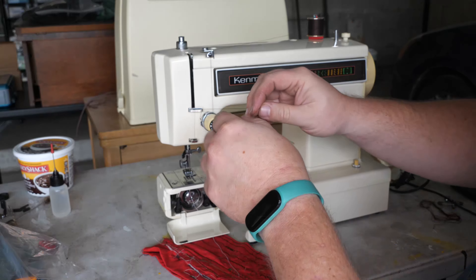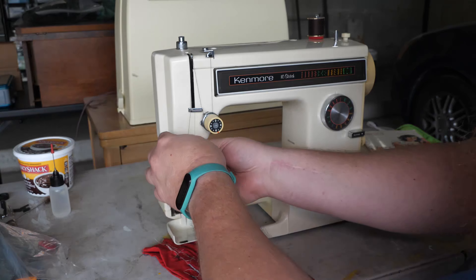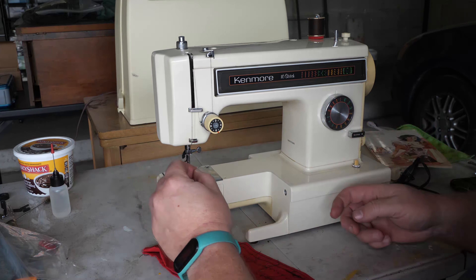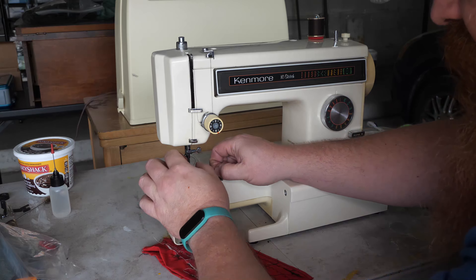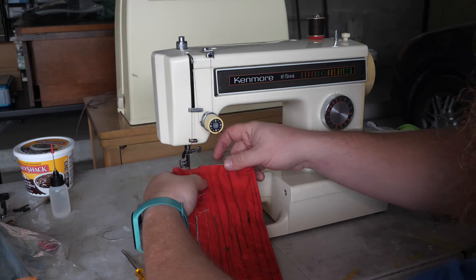This is the Kenmore 1350 — getting it threaded real quick. It was locked up tight because there's an idler pulley inside it, and the idler pulley had frozen up between the motor and the hand wheel. Once we got that idler pulley moving and oiled up, the machine was pretty good. The reverse lever was gummed up, but with some oiling and wiggling and a little time for the fresh sewing machine oil to get in, that loosened up.